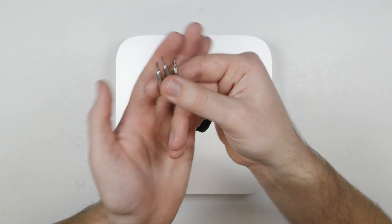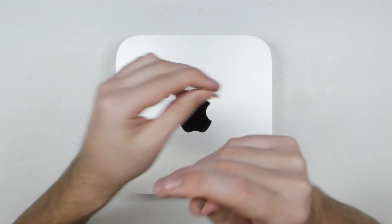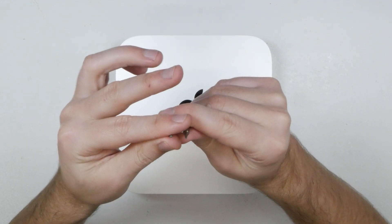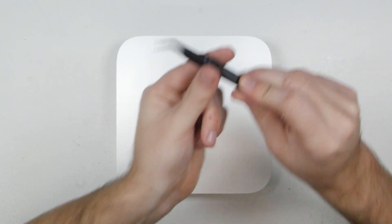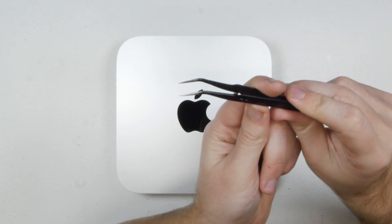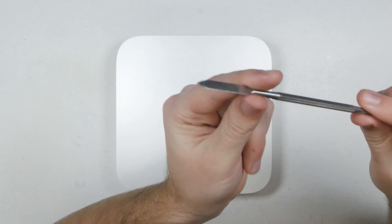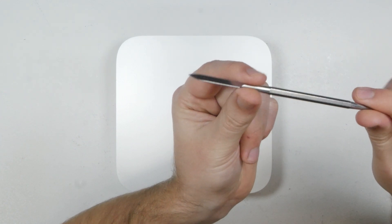In order to do this you're going to need three bits: a Torx 6, a Torx 8, and a Hex 2 for all of the screws. You're also likely going to want some curved tweezers to help you unplug some of the plugs and get to the cables, and something pointy just to be able to take off the back plastic cover.